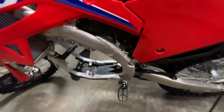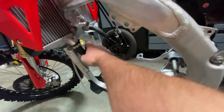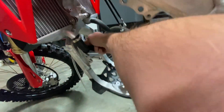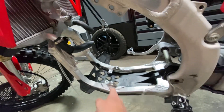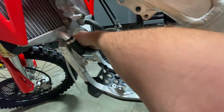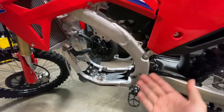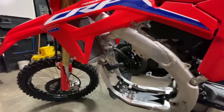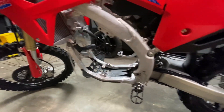For the guys interested in a CR500 two-stroke build, you do not have to cut the front of this frame anymore. The new CRF450 motor has the exhaust coming out dead center in the front, so we can more or less take these motor mounts out, move them to the right spot, and stuff the 500 motor in. The exhaust is going to clear right through the center of the frame, so we're not going to have to cut the frame completely apart. I don't know if Honda was scoping out all the builds going on online in terms of the 500s, but it's awesome that they did that for this chassis.